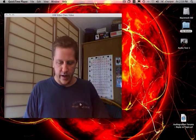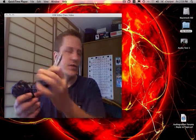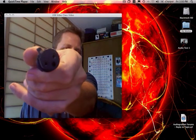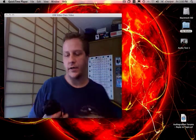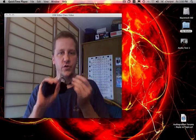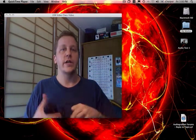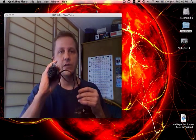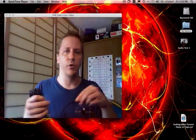Now this comes with — actually it's very nice — a balanced XLR cable. It's not unbalanced. Other cables, I don't know if you can see inside of this or not — the connectors inside have two metal ones and the third hole on the bottom has nothing, which makes it unbalanced. But this does actually come with a balanced XLR cable, which is good. It's high quality. It comes with a super long 26-foot cable. When you're using balanced XLR connectors for something like a 25-foot cable, it has to have a balanced connector on the end. All three of those have metal pieces inside.